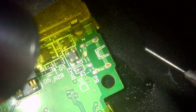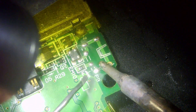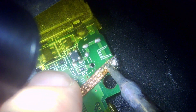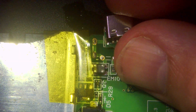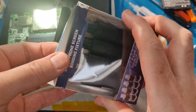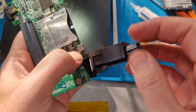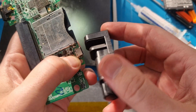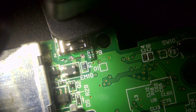Apply a little bit of fresh flux and solder, and try to clean the portholes out as best as possible using wick to clear them completely. If not, it doesn't really matter because we're going to be flowing new flux through them. Line up the new USB-C port. I bought some clamps — normally used to hold screens in place — and I'll use one to clamp the USB-C port into position so it doesn't move when we try to solder.